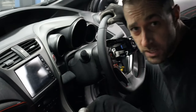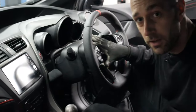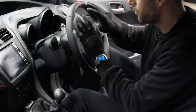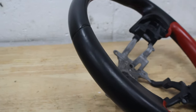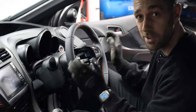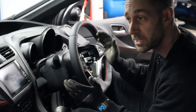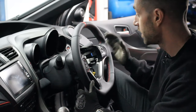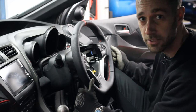This bit's always a little bit tricky when we go to fit another wheel that we've trimmed onto an FK2 or FK8. If it's not the original wheel that came with the car, there could be a very slight difference in that centre spline, which means the wheel could sit slightly off to one side, meaning it would just need a slight adjustment on the tracking. We also advise doing so when we fit a wheel — I'll put this onto the alignment ramp and do that next.